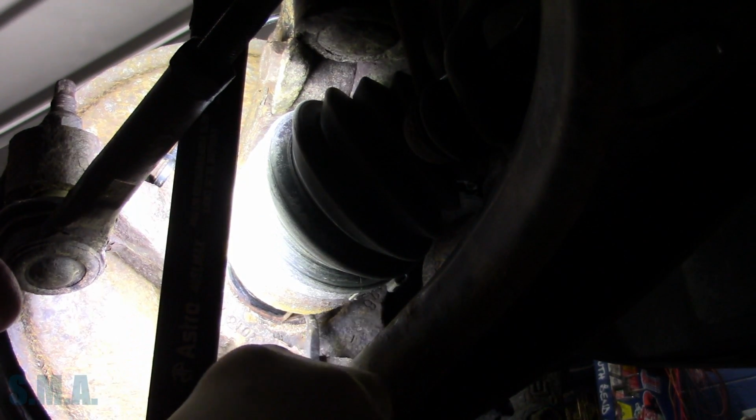that be something? I think I worked on some kind of vehicle not too long ago. It actually had a code in it for something insinuating that it may have stuff stuck on the tone ring. It had a specific code for that. Which I was like, well, that's weird. I don't know if it was a Chrysler product or what it was, but basically it said you got stuff on your tone ring. And I looked at it and it was wrong. The tone ring was actually broken on that vehicle, but I thought it was odd that it had that code or had the ability to generate that code. I don't know, the bottom of this tone ring might actually be chewed off.